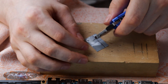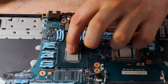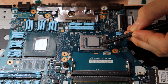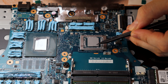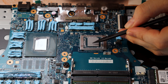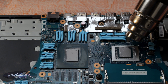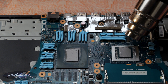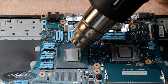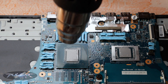Make sure to have a very sharp knife blade for this part. Next, apply thermal pads directly to the chips. Peeling off the protective plastic film from one side of the thermal pad was tricky — these pads are super thin, so take your time with this. I suggest having an extra pad on hand in case of any mishaps. Once I got it right, I placed it on the chip and carefully removed the plastic film from the other side. Patience is key here. Some sources recommend applying mild heat before reinstalling the cooling system, so I tried using 80 degrees Celsius for a few minutes to help the new pad set. Then once everything is back together, the internal heat from running tests will further help it settle in.